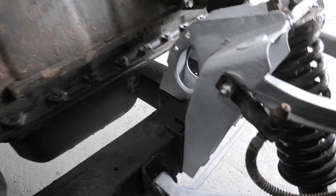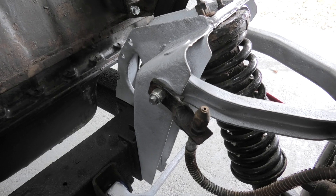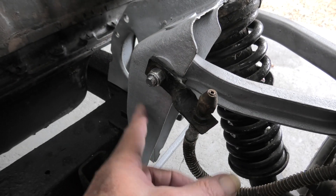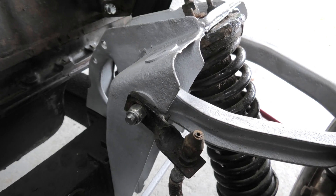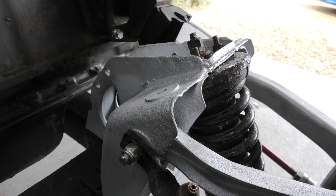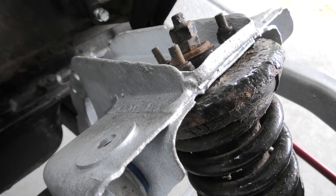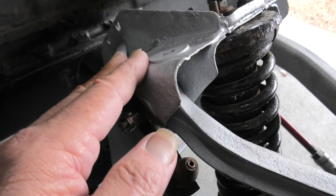To do that — because I won't be doing the actual welding, I haven't got any welding equipment — what I'll have to do is take all this front suspension off, which is no big deal. The turrets — these are the suspension turrets in silver — are held on with three bolts, one at the front there, one there, one on the other side. Take those turrets off, and then with my template and these turrets I can go to my local garage and they can make up and weld the new mountings, which will go here, on that flange. And once that's done, I don't have to take those turrets back off — I can fit them, and that'll be the final fit.